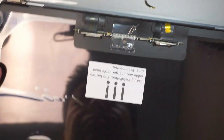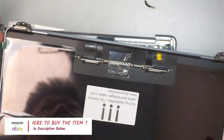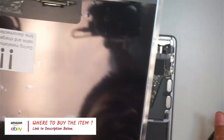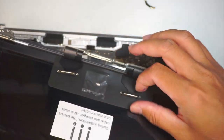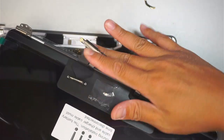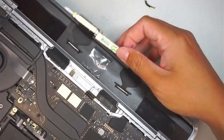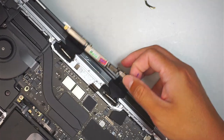Here is the replacement screen. If you're not sure where to buy it, check the link in the description below — I'll link to Amazon or eBay for the replacement screen and tools to help you save money. When installing the new LCD screen, make sure the flex cable is sitting on top of the laptop, not inside it. Push both hinges on the new screen all the way to the back so the LCD board and flex cable rest on top of the laptop body.